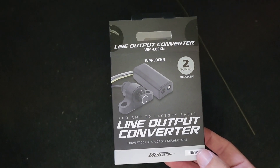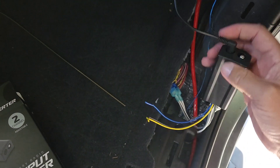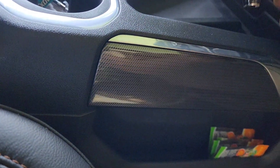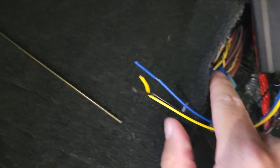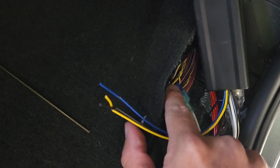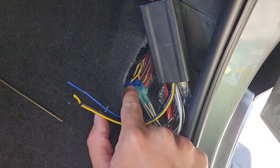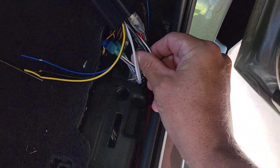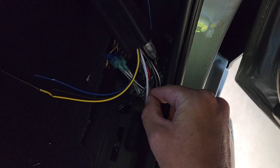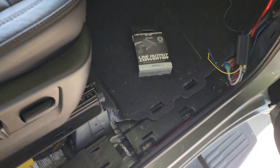I have turned it on, it does work — we'll see how long it lasts but as of right now I'm fine with it. You can see right here where it connects for the bass knob; I've got the bass knob right here. If you're tapping into a Bose system, your wires are going to be the yellow and black and yellow. Use a T-tap — that's the easiest way to do this so you can tap them in and plug your wires in. Make sure when connecting these wires you do negative with negative, positive with positive.